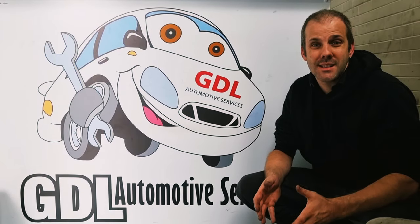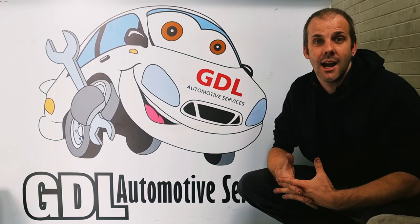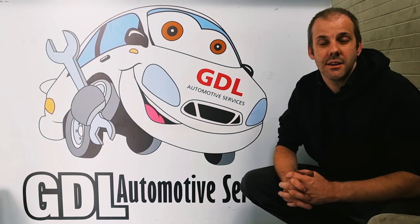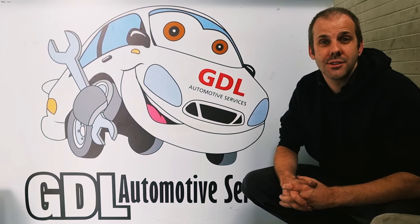Now that you're at this stage, basically you put it all back together in the reverse order of how I've pulled it apart. Once you're all back together, make sure your fuel lines are tight, turn the ignition on and let it sit for about 5 minutes before you try to start it. This should bleed all the diesel fuel through the fuel line so you don't get an airlock.